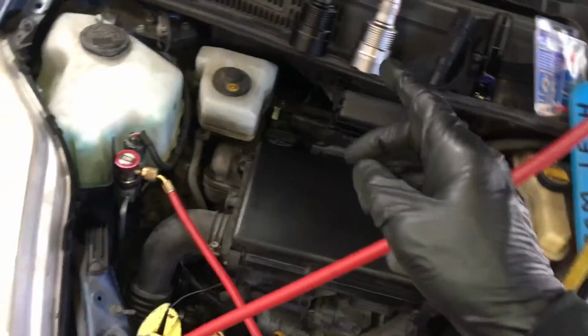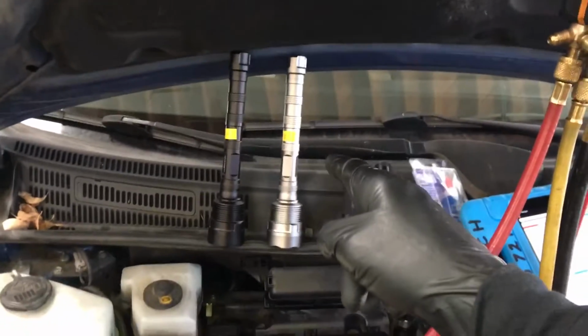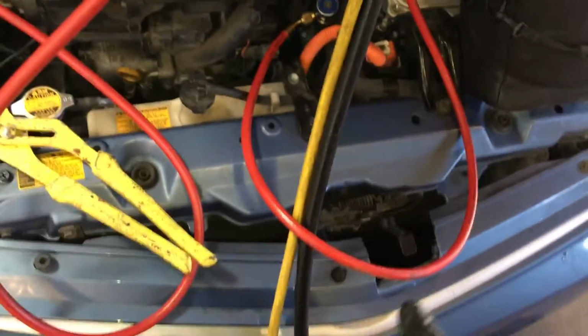and it was burning hot off the compressor and everything like that, then unfortunately this is one of those scenarios on this old 2007 where you will be doing a compressor, an expansion valve that is under the dash, possibly. And if this is the original condenser, you throw a condenser on there, because we all know the old Prius condensers leak like a sieve eventually, and this is a 2007.